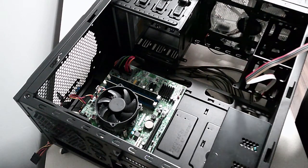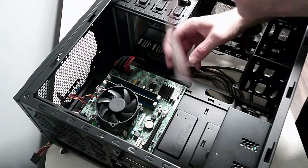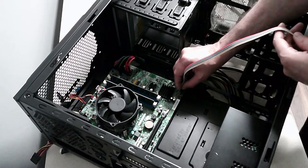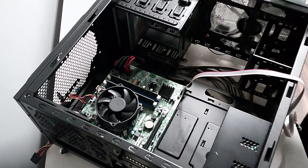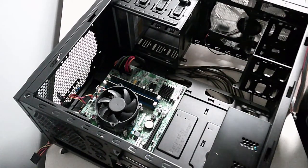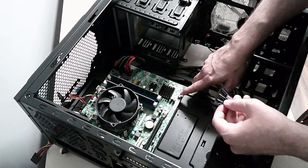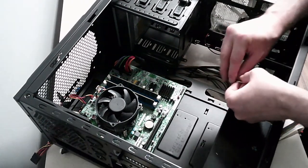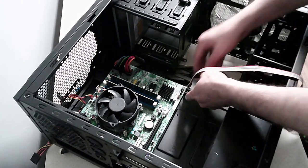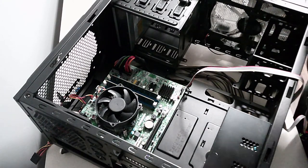Does it matter which way it goes? This is where we could create fire. Okay. So this is the power. Two and four, so one, two would be the bottom. So one, two, three, four, two and four. One, two, I put it in the wrong place. Hold on. No. Supporting the power on off function requires connections six and eight. So six and eight. So one, two. There's the third one in. Like so. All right, that's one connector in. And then the reset is five and six, five and seven. So that's the bottom ones.